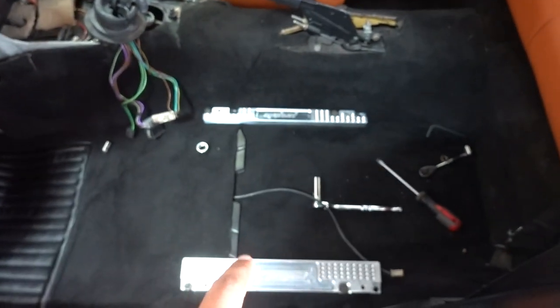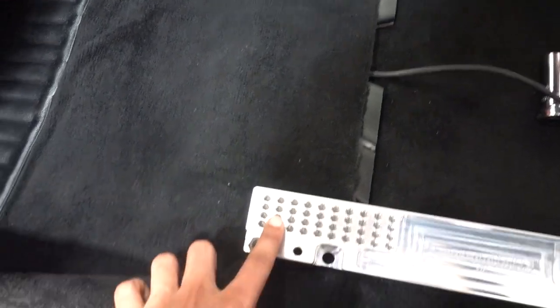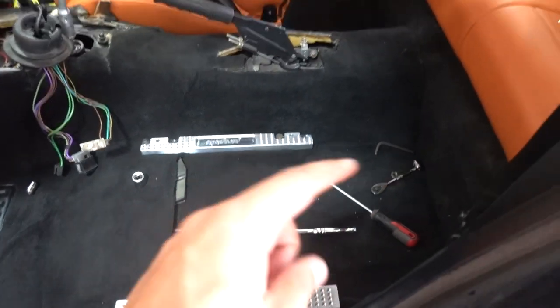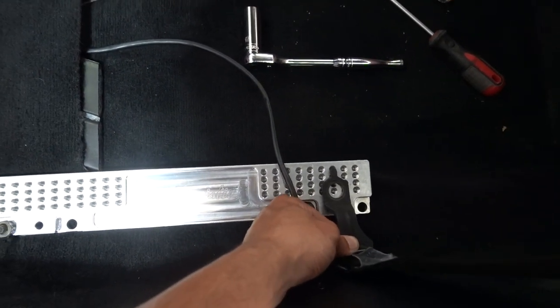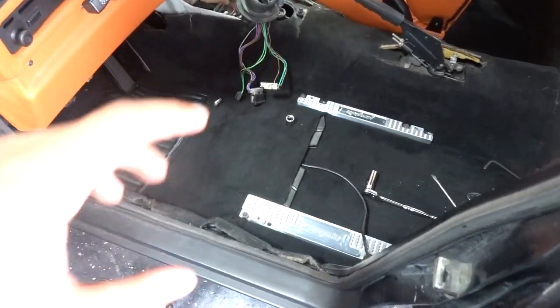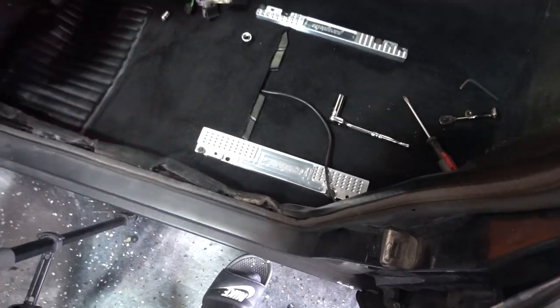Just like that side, we got the new mounting brackets in. This time we expedited the process since we know exactly how that seat was sitting, so we're just going to start mounting up the actual seat itself. We made sure to plug in the seat belt harness to the buckle and then did the exact same thing with the actual seat belt and bolted it down. It's not the best way, but at least we have a seat belt rather than not running it at all. This mounting system is super nice — if it wasn't for this I would have had to get an E30-specific one, but there's nothing to say the seat would actually fit. These universal ones are amazing and they're made for the E30, so they bolt right into the E30 and then go universally to most seats. Shout out to Garagistic for this.